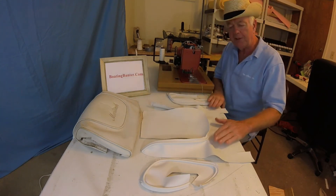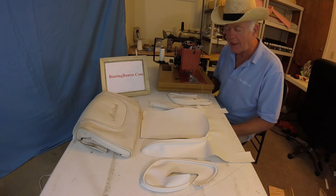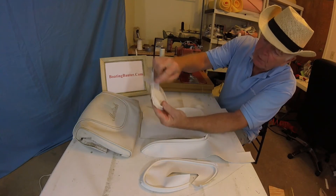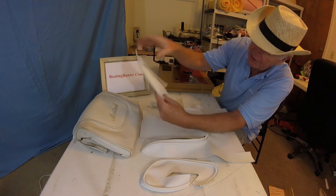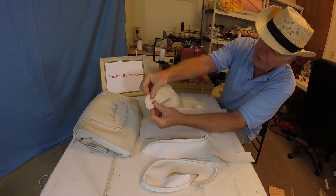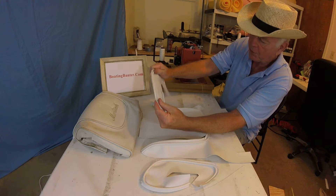I want to show you how to sew — the sewing on these is really tricky. I haven't done too many headrests and they are hard. There are a lot of turns and curves; you can see these are the sides. What we had to do is score the piping so that it bends. You can see the bend is very, very tight — right back on itself. So I had to put a bunch of scores in there in order to make that curve.